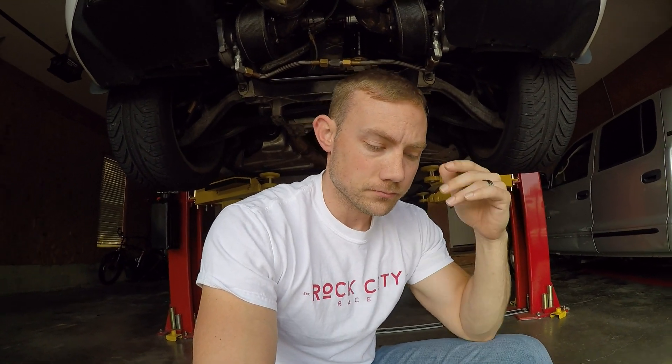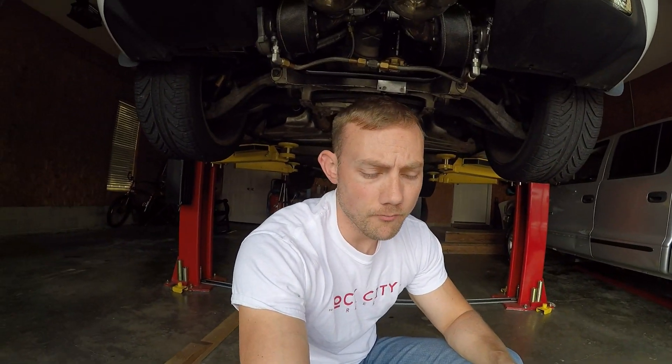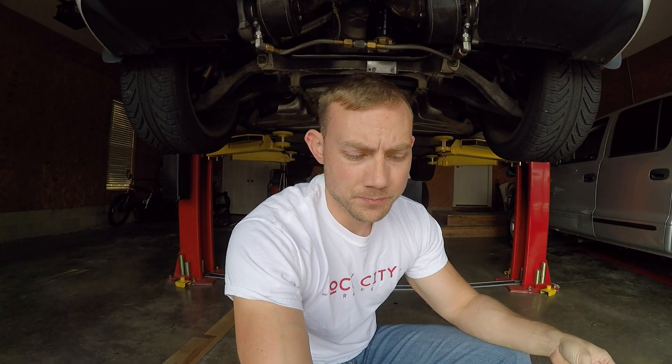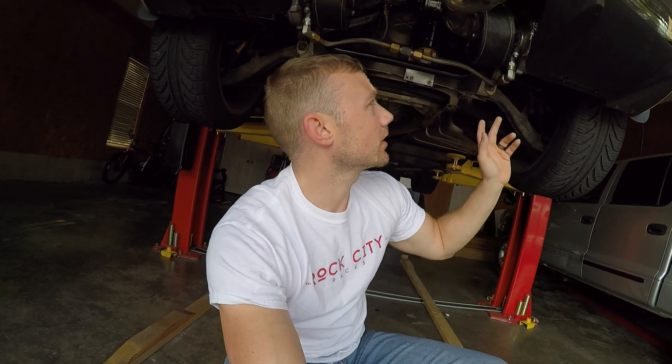The Spartan oil pump that I bought, while it's a lot quieter, doesn't have enough flow to out-pump both of these turbos. The problem was at idle and cruise I would not get any spray in the turbos. But if I get on it and go up to 5,000 or 6,000 rpm it sprays oil out of the turbos — gets it in the exhaust, in the compressor housing, everywhere.